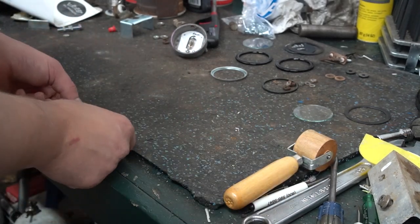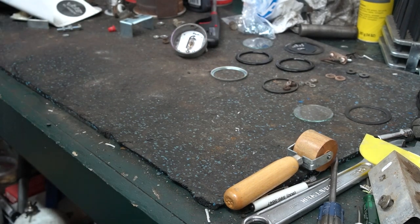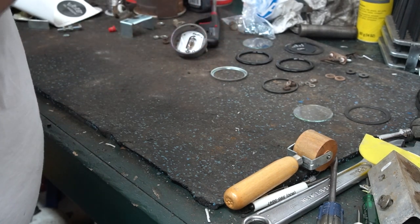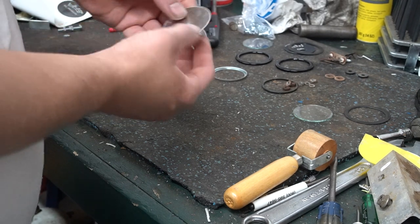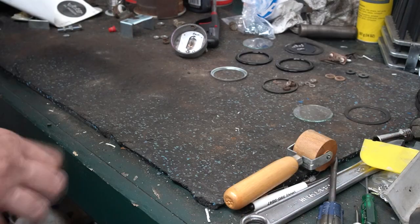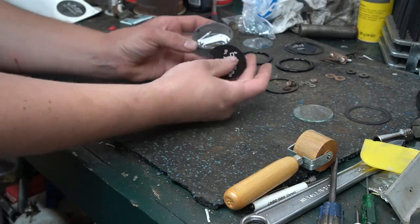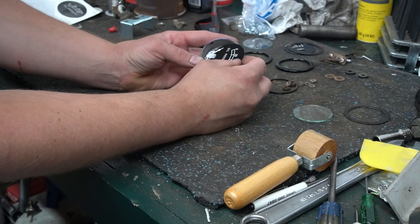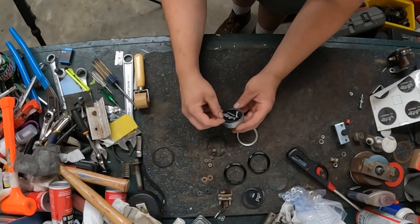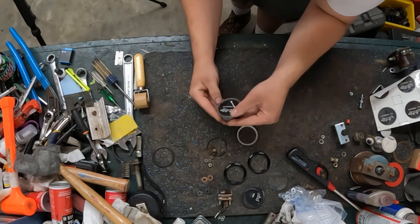Okay, so there's my new gauge face on there. And these were made just a hair larger than the originals. I actually centered that one pretty good. So I need to come in here and just kind of trim out, and I especially got to trim where my needle goes. So there's that all trimmed out. So now I'm going to take the gauge face, kind of slide it underneath the needle, and it's going to set down into the housing on a couple of little perches in there.